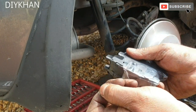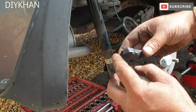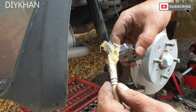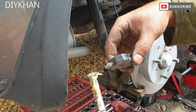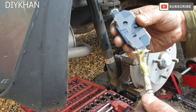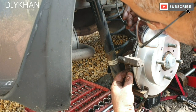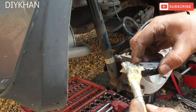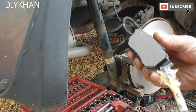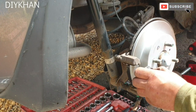Here come the new brake pads. Before I slide the new brake pads in, I'll apply grease on the guide arms — both sides, here and there. Just a little bit, not too much; just gonna dab it. Just gonna slide it in here like that. Gonna do the same on the outer pad — a little bit of grease on the guide arms, same on this side. This pad is gonna sit here like this.